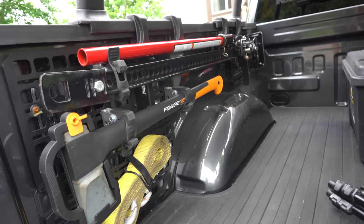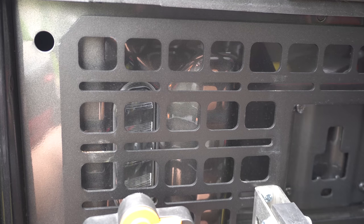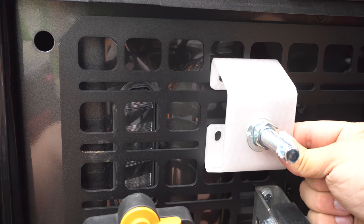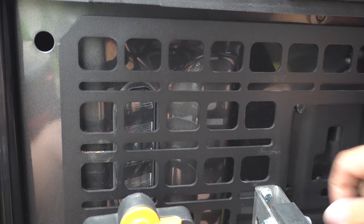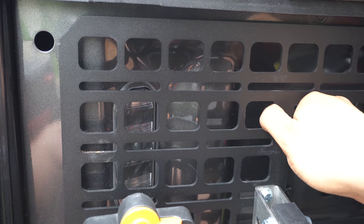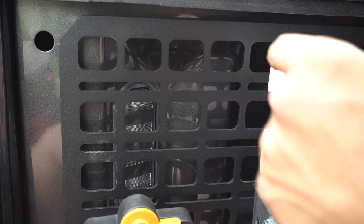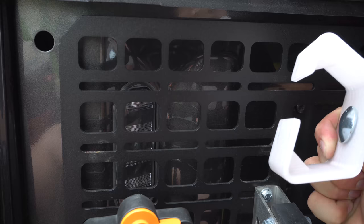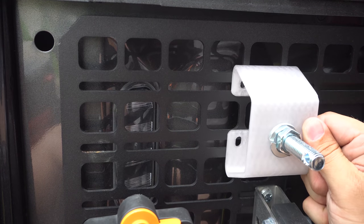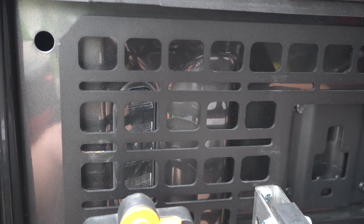The first thing I'm going to do is remove the high lift jack, the current riser mounts, and QuickFist clamps. So we've got our first installation point here. I'm not going to be really picky about where I put this since we're probably going to move it around, but I want it somewhere close to the actual mounting points of the bedside racks, since that's the most sturdy area of the panel. The profile of this is not exactly symmetrical — we're wanting to lock it in up here and the weight of the jack is going to push the bottom of the bracket back into the panel.